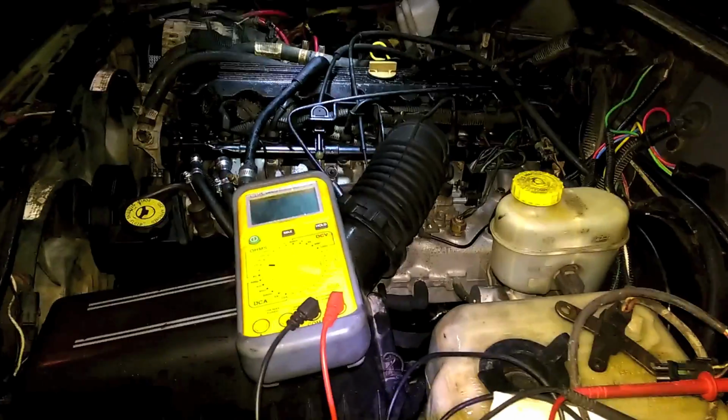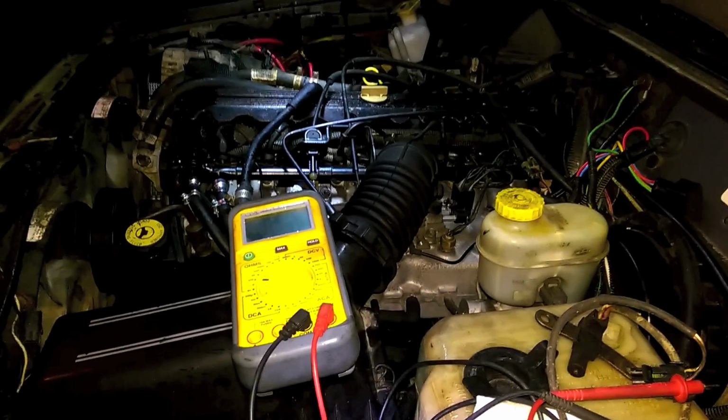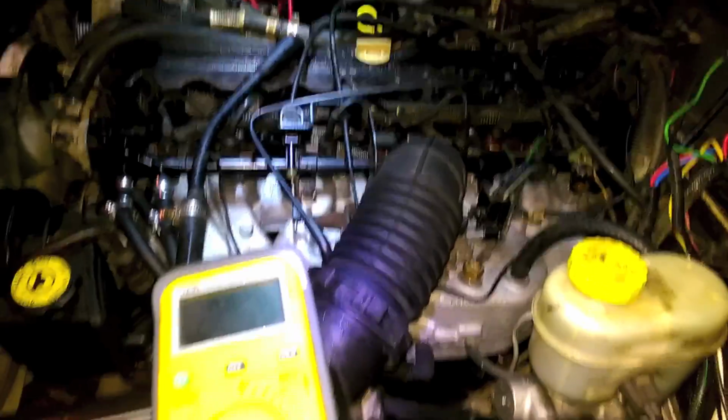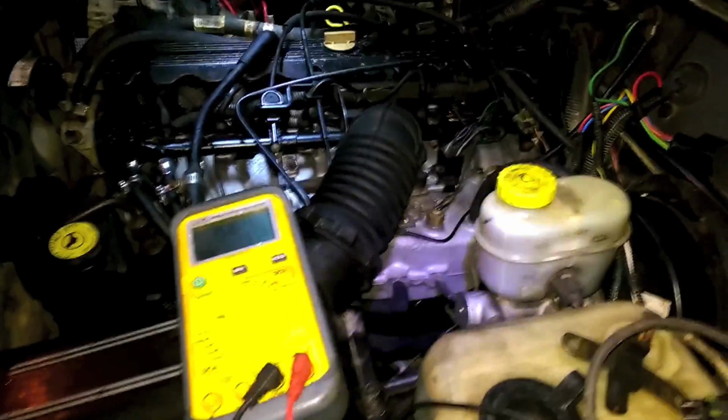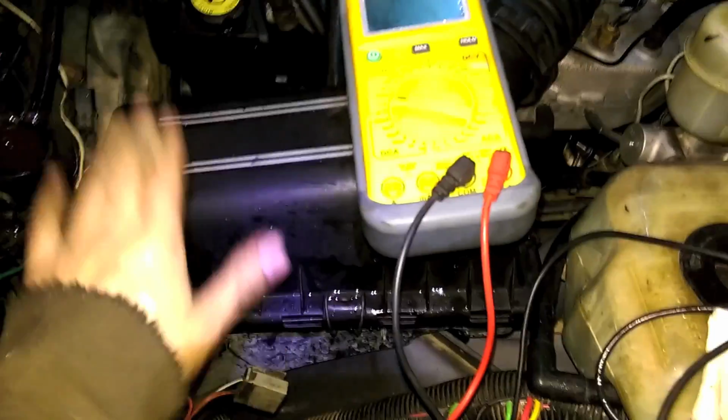Alrighty, time to get into the engine diagnostics. So, basics for an engine to run. We need fuel, we need air, and we need spark. Air's the easiest. Got yourself an air filter, air box, hose, everything's good. Throttle body opens. Snorkel's not full of debris. Okay, air checks out for the most part.